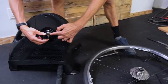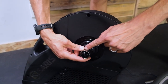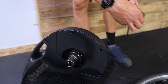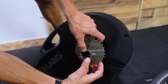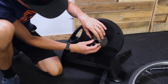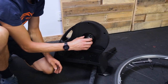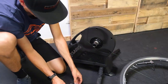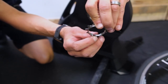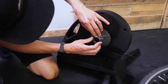Before we put it on, I'm going to spin this free hub and you'll notice that one of the lines is narrower than the rest of them. So now that I know where that is — there's only one that's narrower — I'm going to peel the cassette off, hold it between my fingers, and look for the narrow one, which is on the inside there. That way, when I slide this on, it is in theory not going to come apart in a hundred pieces. That spacer that was provided is probably for a 10-speed system and Jesse has an 11, so I'm going to take the spacer off. Flops on.